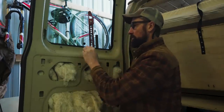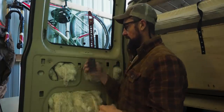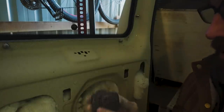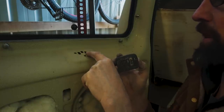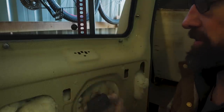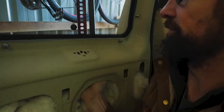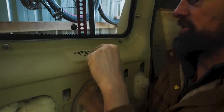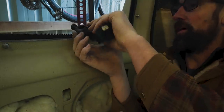Now we're going to install the provided hardware. Your door should already have the little cutouts for the buckle mount, so you just need to reach in through the door to put this piece in. We're going to put this little metal backing plate in — it's got a couple of little tabs that will come through these two holes and then buckle up and over. You want this metal tab facing towards the back of the door. Reach up, shove it through, then use that tab to pull it towards you with your fingers. It may be a little harder if you have Line-X, as that adds thickness, but it should line up and you'll see the three screw holes coming through.